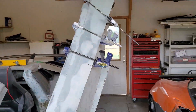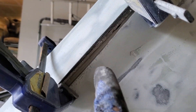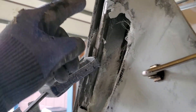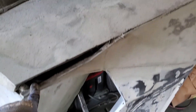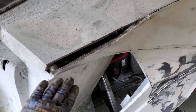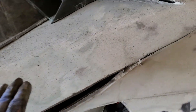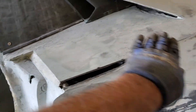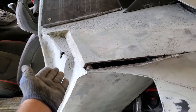Basically we're going to cut the corner off. What I did was lay a straight line and cut out the door pieces. I'm pulling the structure in and I'm going to fasten it with screws to the skin, then fiberglass over it. Same here — I'm going to bring this area in so we'll have a really nice transition just like the real car. I also have to make sure it doesn't have a hump, so I may have to cut this area and lower it down a little bit.